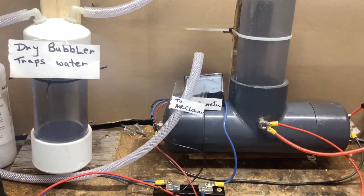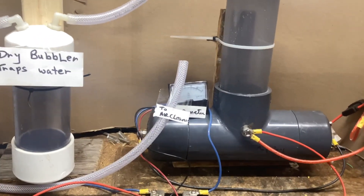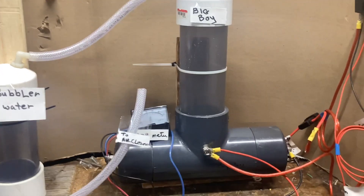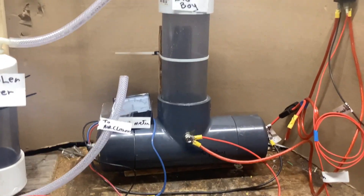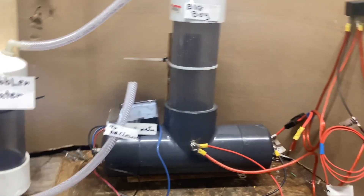I had this one running at 20 amps and it was putting out 750 milliliters per minute, which is enough to run about an 8-liter engine. We put these on semis — I had about 17 semis with this same thing on them, running around 16 to 20 amps.